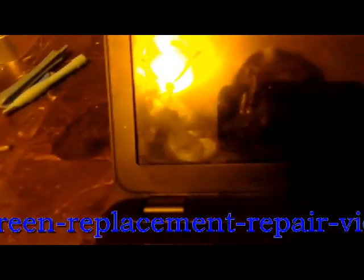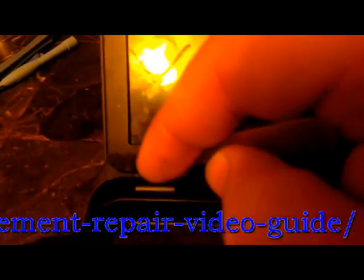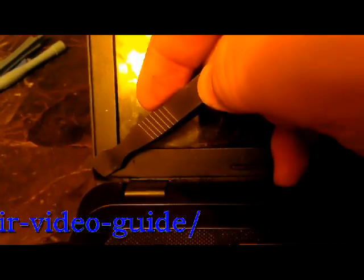Let's start off at each corner of the bottom of the screen. You're going to see these little covers — it's a thin plastic sticker. You're going to remove those. I've already got one off. I usually just stick them on the palm pad. Underneath the sticker, you're going to have a screw on each side that needs to be removed.